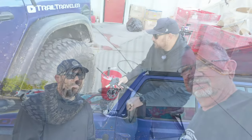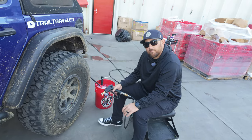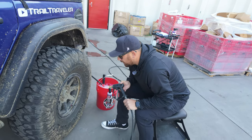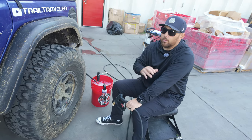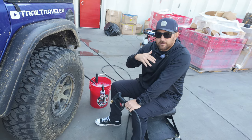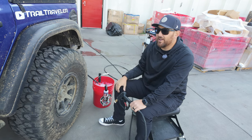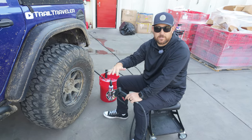Good, let's get started. Now, we mentioned in the last video the right way to start a cleaning process, and that's with the wheels and tires. Explain again why we start there. Yeah, so the magic word, water spots. Realistically, if you're doing this at home, you would have done the whole car, and so again, taking steps forward and not backwards. Instead of blasting the whole car down, as much as it's tempting because you want to see the water behavior, you want to minimize the chance for getting water spots. And so always start with your wheels and tires first.